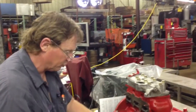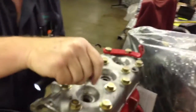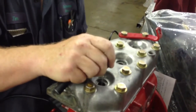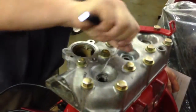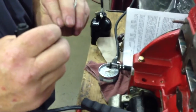I'll just throw this in here quick and we'll do a squish. Again, I'm going parallel to the pin, run it up, and as I spin the motor I almost lock up right there. So now I take this off and measure it. This was 63 thousandths solder, and I'm going to find that I'm hitting the block on this one.